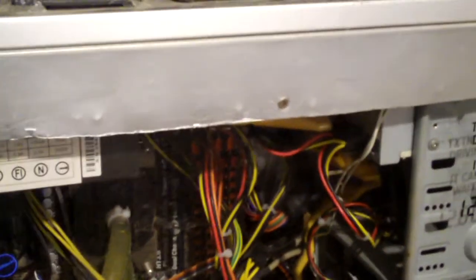And I'm about to upgrade the hard drives in this thing. I got two 1 terabyte hard drives and a 2 terabyte single drive to upgrade my setup. Currently, this computer has two 500 gig hard drives and a 1 terabyte drive. The two 500s are in a RAID stripe and the 1 terabyte is a backup. So more or less, I'm going to be doubling my space to 2 terabytes from 1 terabyte. Of course, shooting all these videos for you guys on YouTube has made a big contribution to space getting taken up on this thing. Not to mention, I also record TV shows and everything else.